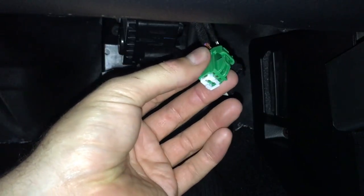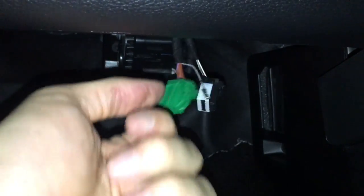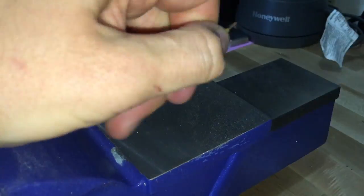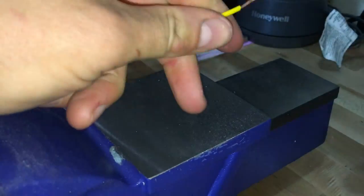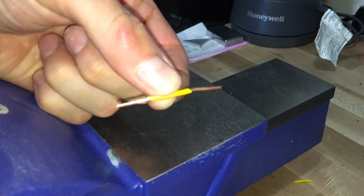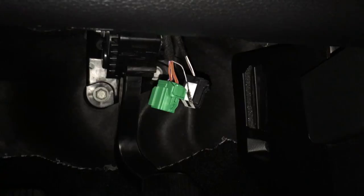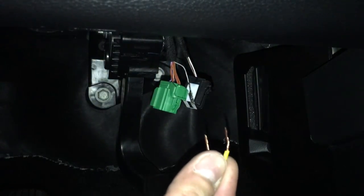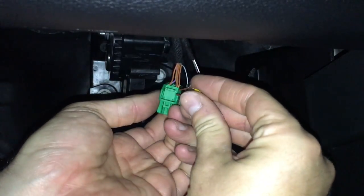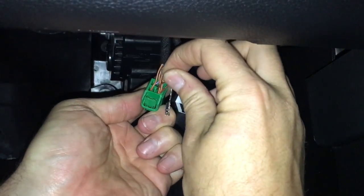Once that's out, you can really pull the pin out. Ford has a grayish pin that is only providing power under five miles an hour, so once you go over five miles an hour, those lights turn off — it cuts the power to them. The wire right next to that is 12 volts all the time. So what we're going to do is jump that constant 12 volts to the hole from where the speed-limited pin was removed.